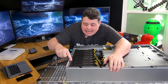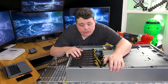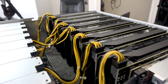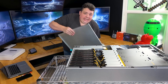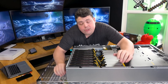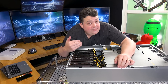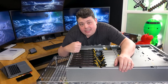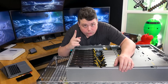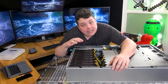Sitting in the back of the chassis, you can see that we have eight graphics cards. These are EVGA GeForce 1060 six-gigabyte graphics cards. They each require external power from the power supply, which comes in from the top down — which is the reason we need this lid with a giant bulge on it. Normally these rack mount servers don't have a giant bulging lid, but it's nice that Asus offers that option. This case is capable of holding not only 1060s or 1070s or 1080s, but even Teslas or higher-end graphics cards, given the raw power delivery and airflow. Special thanks to EVGA for providing four of the GPUs, with Puget Systems providing the other four.